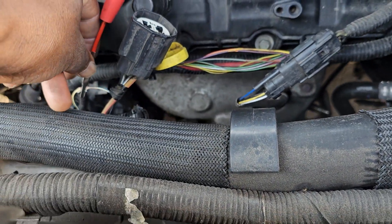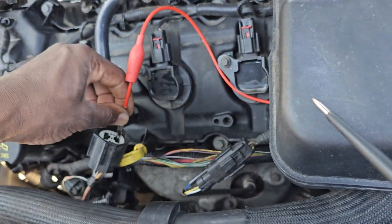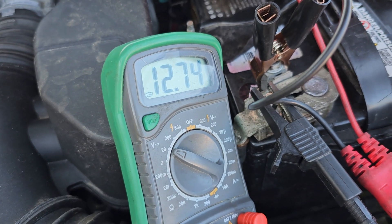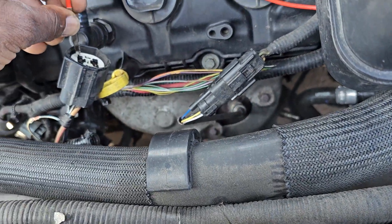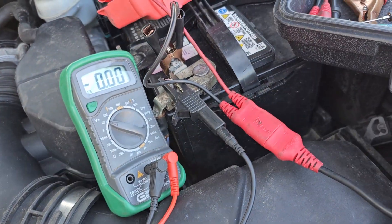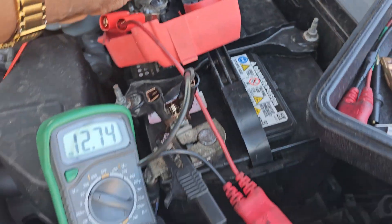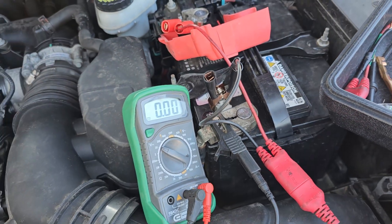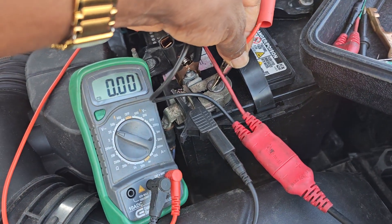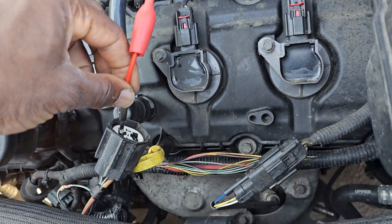The gray one is power. If I put power here you're going to see 12 volts; I take it off — zero volts. I put it here — 12 volts. That means power must come into the computer all the time. The second wire is ground — like nothing. If I put this wire here we will read 12; if I take it out, zero. The whole body of the car is connected to ground, which is zero, so if you put it in you should get zero voltage.